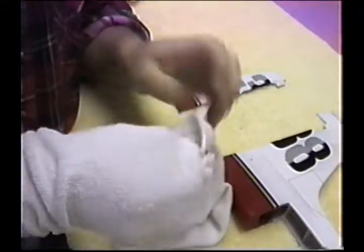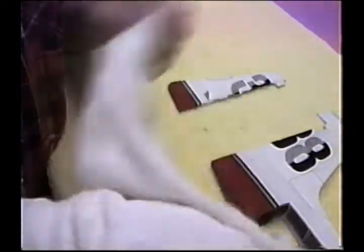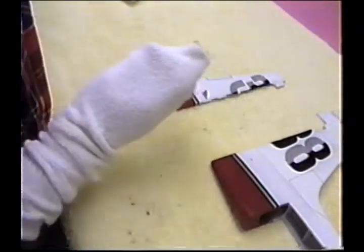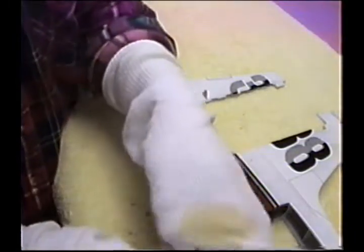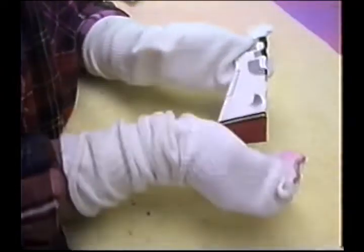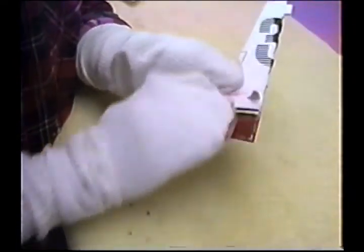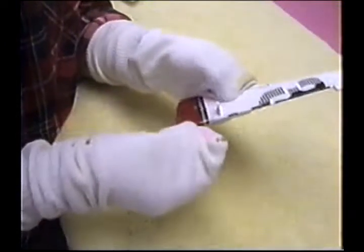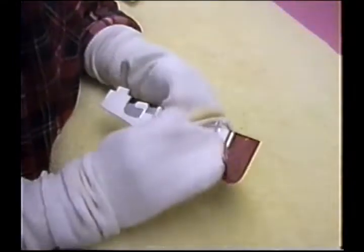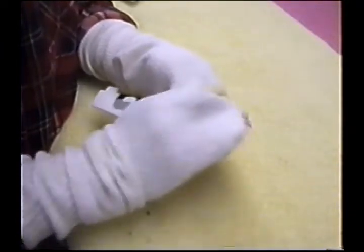On a complex part like this, one of the techniques I've had is to use the socks as mitts instead of polishing pads, at least to start with. No matter what happens, every time you're touching the plane you're buffing it to some degree. On a small part, always get the small parts first — get some compound on there and do one little spot at a time. I always want to be real careful around the hinge lines — that's where I tend to go through anyway. Using the socks like mitts for buffing is a very handy way to do it.